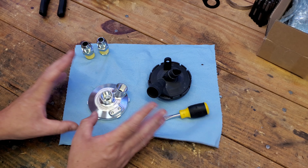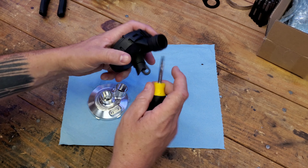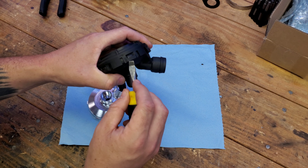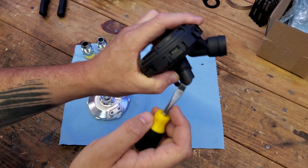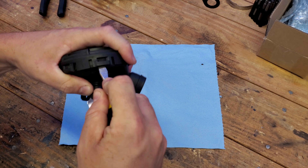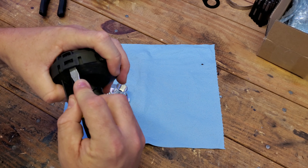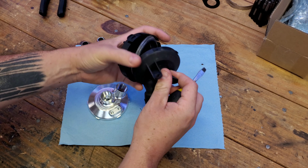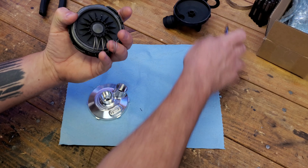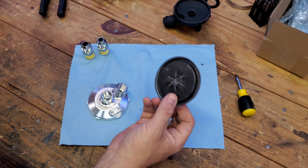The way you put this together is really simple. It helps to have a screwdriver. You're going to pop these tabs — you can see all the way around this housing on this lid, there are these little plastic tabs. You just want to get in here and gently pry. Don't get anything way up in there where you might damage the rubber diaphragm — just walk it around and eventually it'll pull apart. Once we have it open, you can disregard this piece. You've got a spring, a rubber diaphragm, and the cap. Make sure it's clean.